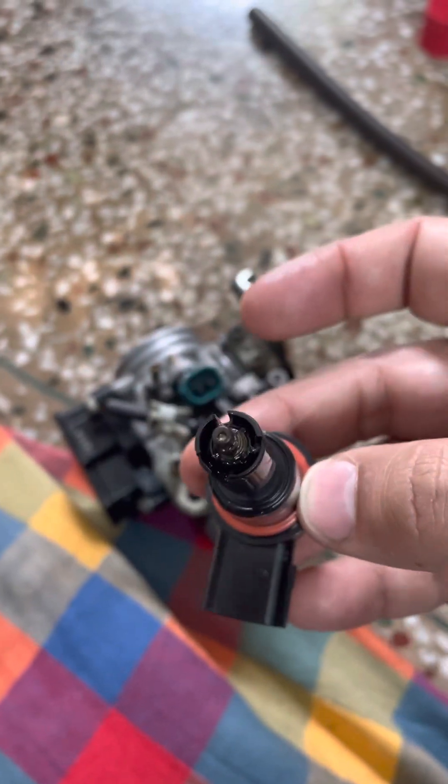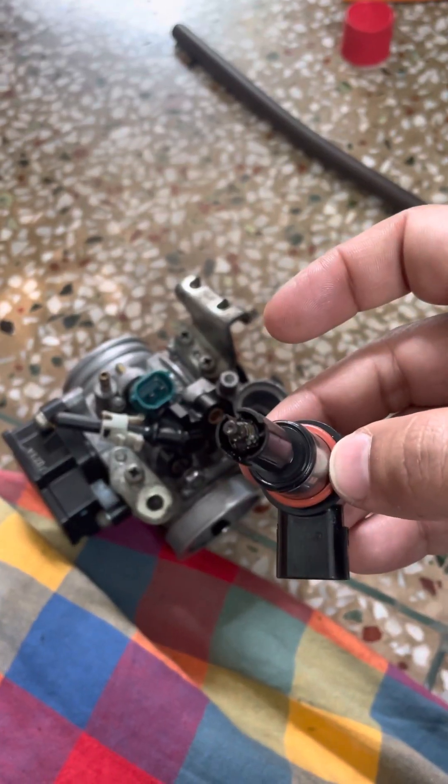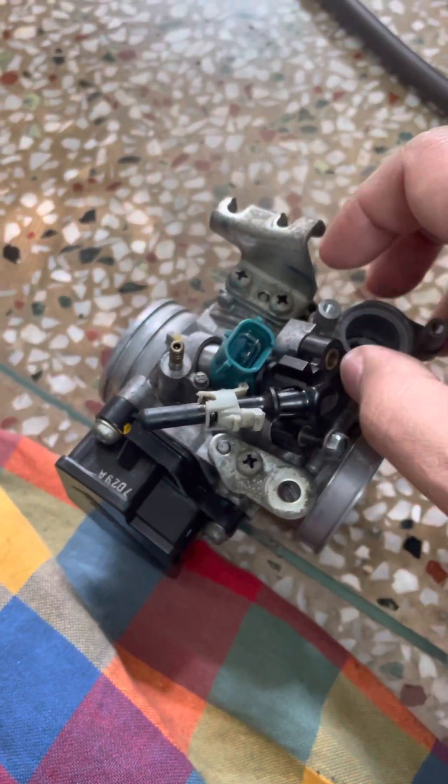You can see it's having some debris, so we will clean it with a spray of WD-40, which you can see there. Hopefully the idle problem of the CBR 250R will not happen again. We'll keep that aside and now move to the injector part.